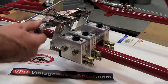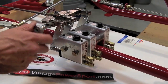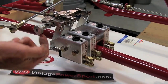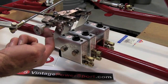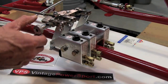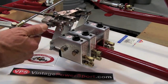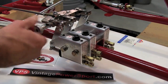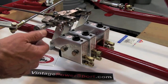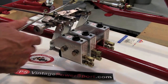As I turn this knob, you can see the pin there moving away from me, and turning this way it moves towards me. There's a spring inside this knob that maintains friction to keep this from moving due to vibration while the cart's running. A really simple mechanism, but these types of balance adjustments are very, very effective on carts — they do a really good job controlling the balance between the front and rear brake.